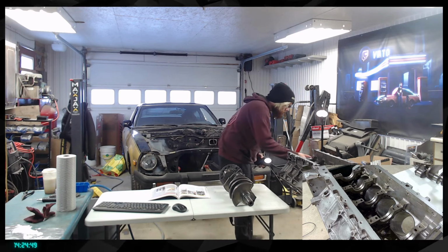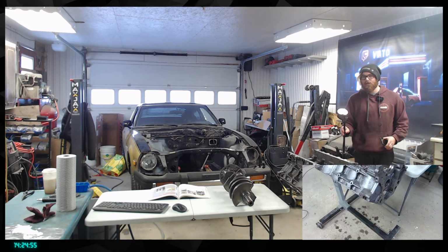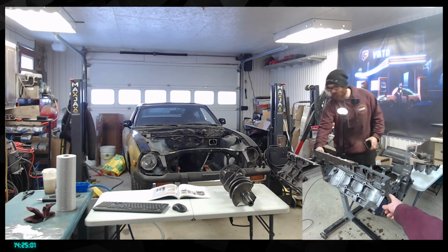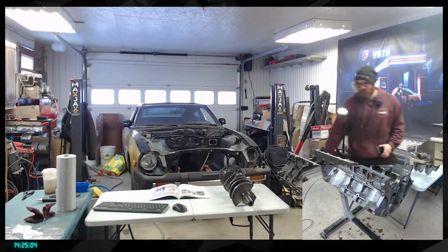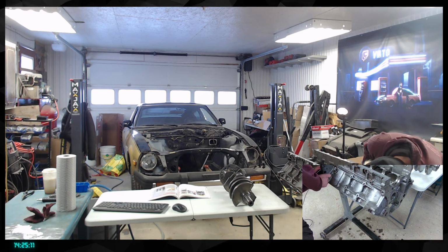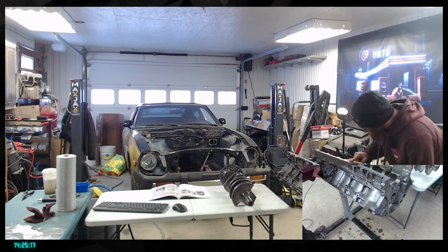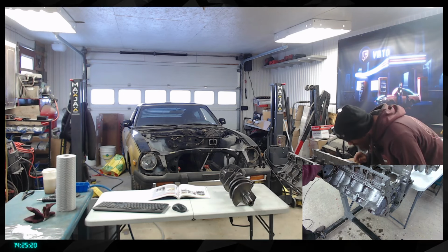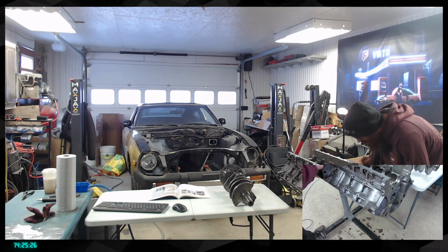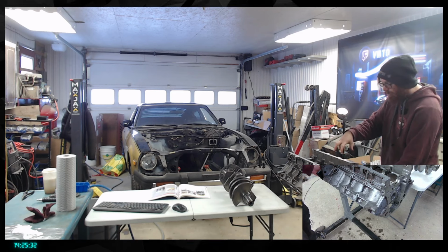These ones, the one here is plugged. So if you want to understand what I'm looking at right now, there you go. I realize this one is already capped, but basically this is the oil gallery going from the front to the rear. At the rear here, I have a pretty good visual of what's going on in there. So this is where oil is coming through. This is the place where the oil's getting in, and here's the side where it's getting back down. One thing you have to know is that when the oil pan is in here, this is where the oil filter is going.